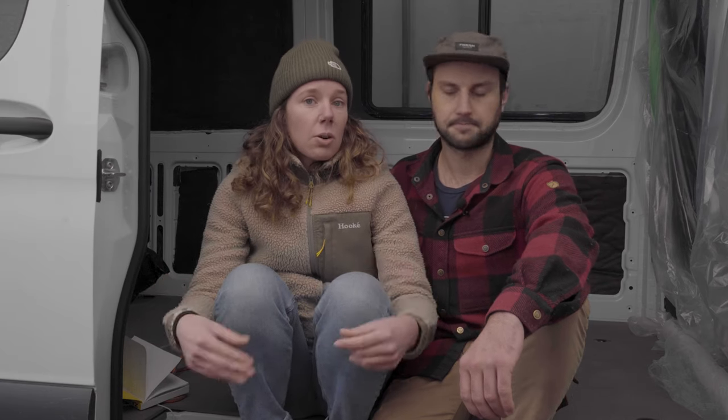We are using spray foam in the places we can't access, but that's really the only place we can't put Thinsulate. It's also very easy to install and not messy — foam pieces ended up everywhere and was pretty wasteful. With Thinsulate, you'll end up barely wasting any because all your leftovers can be shoved into little cracks. And probably one of the biggest reasons we chose Thinsulate was the R-value: about R-4.5 per inch, which is super efficient. It's also hydrophobic like foam, so if there's humidity in the van it will still work because the fiber doesn't absorb water.